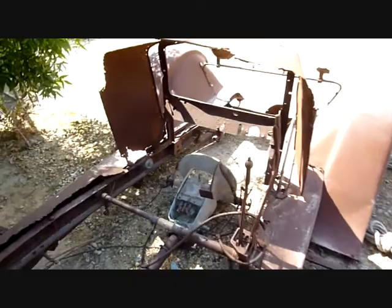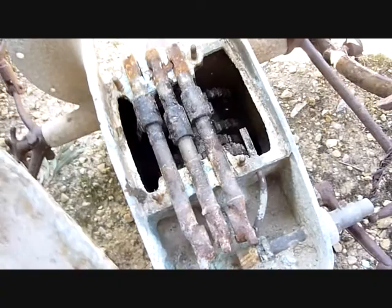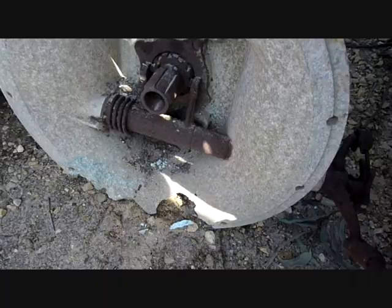Now the gearbox, we also got a gearbox with it, but that's pretty well rooted. I've taken the top cover off, but it'll come off with one hand, see how we go. And it's not too bad inside. I mean, some of the gears are usable, some are a bit chewed. We can use some parts from it, but most of the rest of the gearbox has had it. For example, the housing is all cracked through there. You can see it should be perpendicular to that shaft, the one that comes through here, but it ain't. And then also, because it's been sitting for such a long time, it's all corroded, and you can see that crack down there, so the rest of it's stuffed. You can get a few good bits from it.